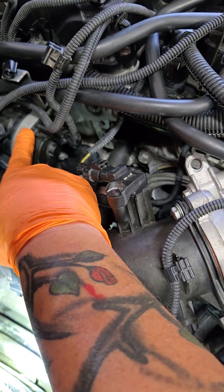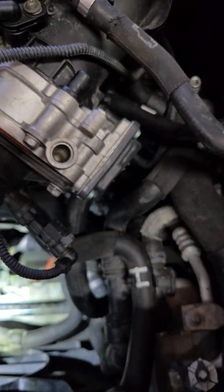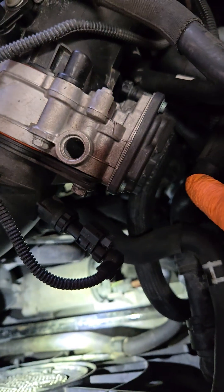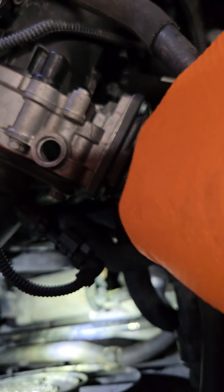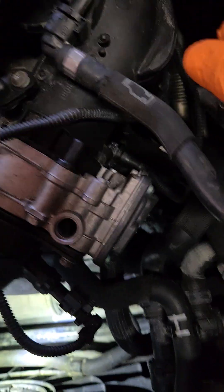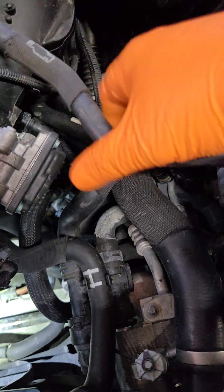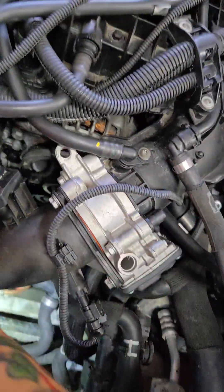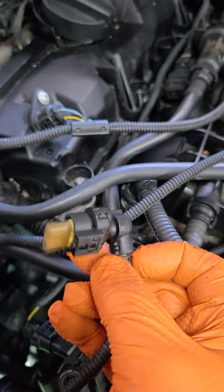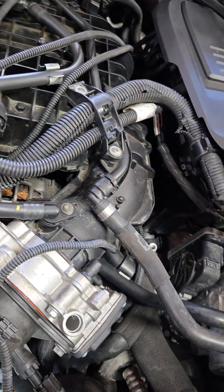The plugs are the same, so if you switch your plug, your turbo auxiliary water pump is not going to turn on. That means your AC is going to always be hot and it's going to build pressure because you've got your AC compressor cycling on and off, giving you hot air and almost 500 psi of pressure on the AC system.